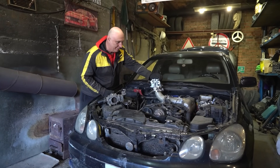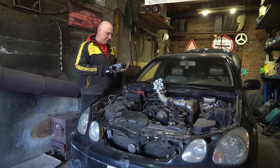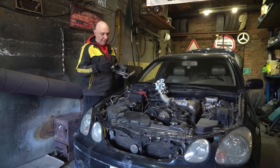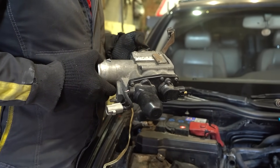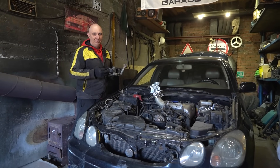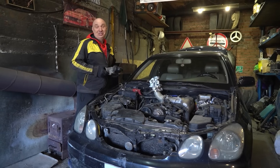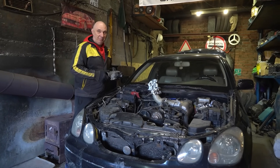Okay, so it's on there, everything is good. I do need to say something. On this you have got a couple of sensors — first you have the TPS, also this servo. These need to be connected. Obviously the throttle position sensor won't be doing anything, but I'm afraid that without it, the car is going to be throwing all sorts of codes at us. I don't know what to expect, but we'll find everything out soon enough. So let's get everything hooked up and try going for a drive.